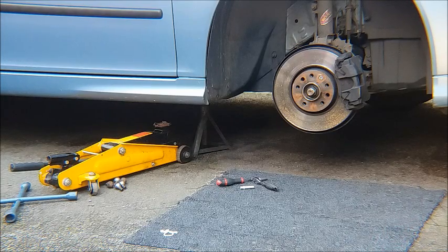We've reached another critical phase. In order to disconnect the drive belt from the alternator, we need to access the drive belt through the wheel arch with the wheel arch protector removed. As you can see, I've supported the car on an axle stand just behind the front right jacking point and removed the wheel. Now I'll show you how to get the wheel arch liner out.